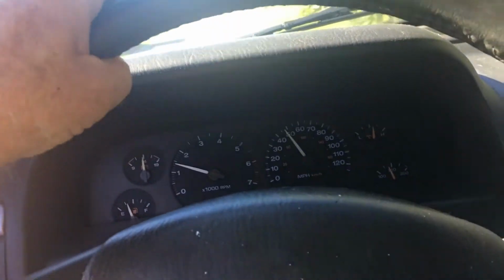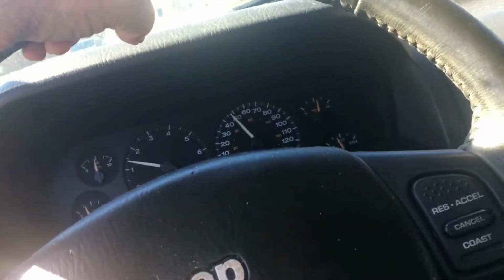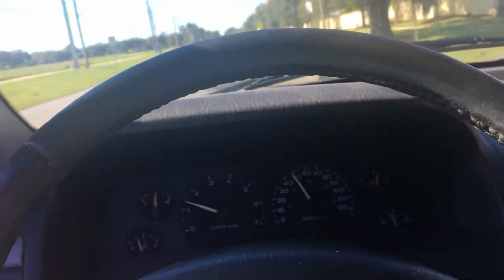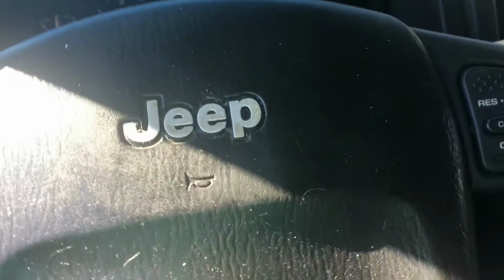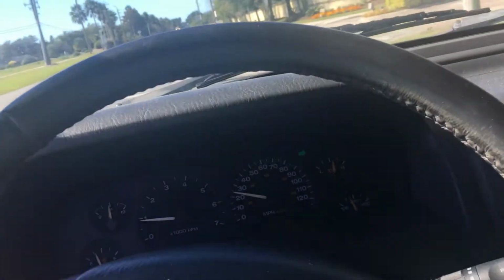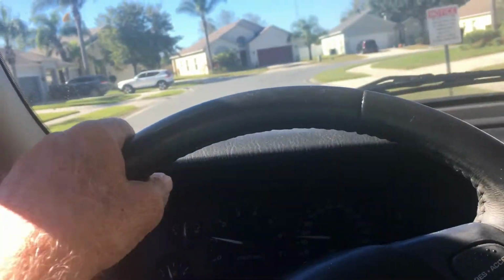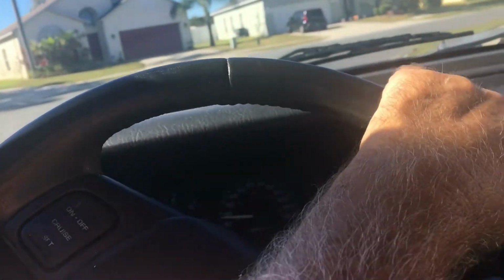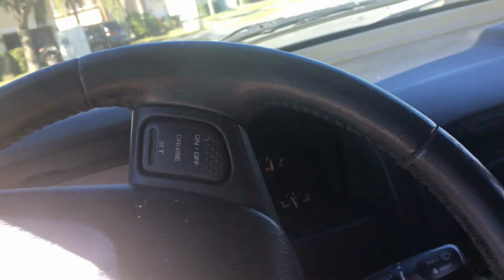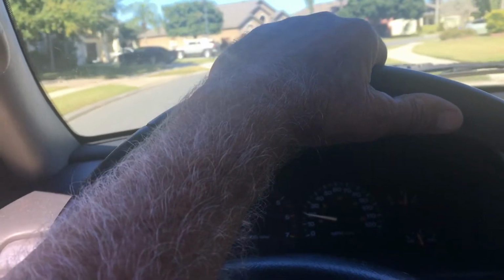Cruise control works fine. I don't see no light anywhere, but it does engage and it's working. So that particular system seems to be all right. Like I said, it's tied in with the vacuum lines at a T there at that high vac module. So anyway, this thing is running pretty good, but again, I've got the vacuum hose off that works the heater vent and AC vents. With that hose on, again, as I said before, it idles real low, misses, shudders and wants to quit.